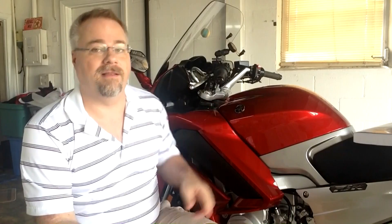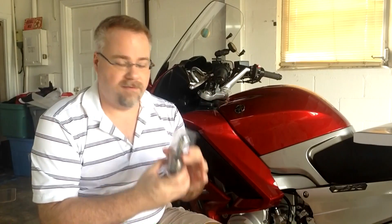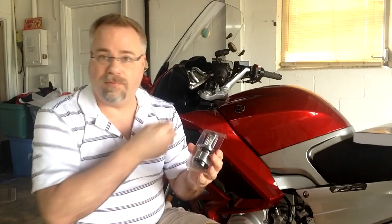On the 2014 it's pretty easy to get to the battery and get that right side off. On the 2013, not so much — you have to take off the entire dash panel. So 2013 owners, consult your manual to get through this first step. But after that it's cake — should be just removing the bulbs, fitting the new ones in, placing a little wire adapter, and we'll be good to go.